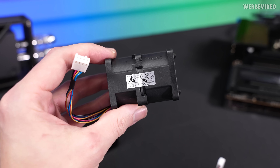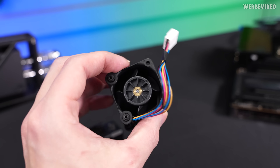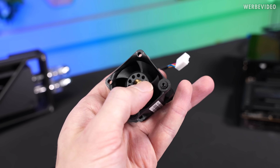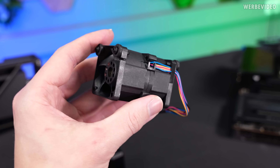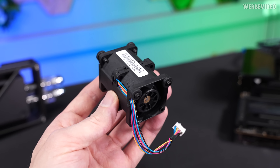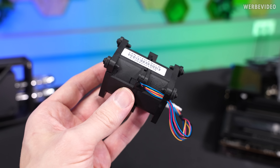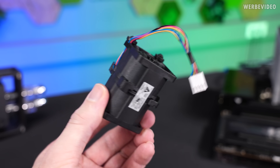The fans are Delta Electronics counter-rotary fans. That means two fans are connected with each other and counter-rotary in terms of their spin orientation — one spins counter-clockwise, the other clockwise. They also have different blade geometry and different speeds: one spins at 20,500 RPM, the other at 17,000 RPM. The power consumption of one of these fans is 18 watts, which is enormous. Completely forget about hooking two up to one motherboard fan connector — that would just be too much current.